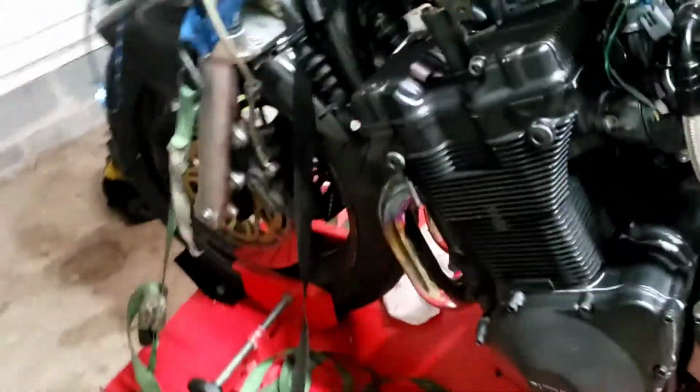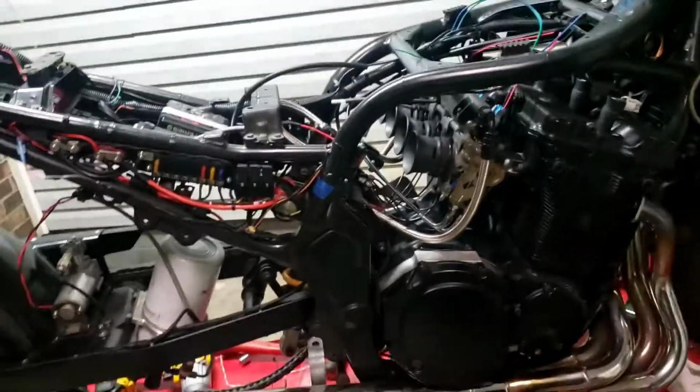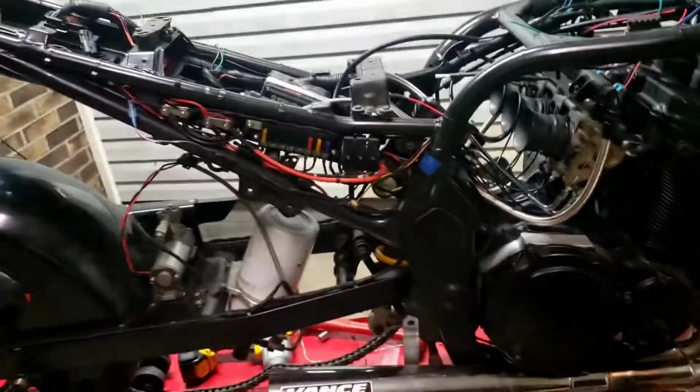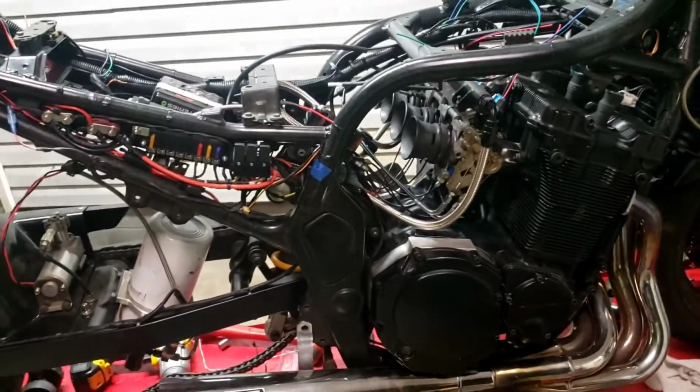So my minimum RPM I spray this motor at is 3,000. Yeah, I know, way too low. I spray it at 3 grand, that's rod bending territory. That's where I gotta spray it to get out of the hole. Hoping the new shock helps with that issue. I can run a lighter tire pressure, have less drag coming out of the hole, and stand it up.